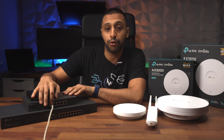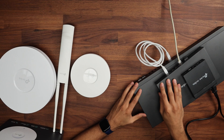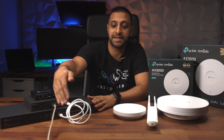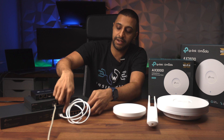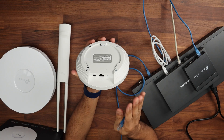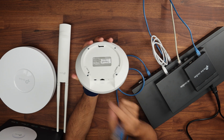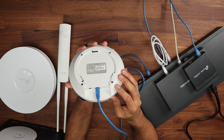This goes straight into the first WAN port just here. We're then going to plug our router into the switch — connect it up to port one on the switch itself. Your internet connection comes in, goes into your router, then into the switch, and anything plugged into here will also get an internet connection. We're also going to plug the three access point devices and the cloud controller straight into the switch. On the back of the access point you do have DC power if you don't have a PoE switch — it comes with a plug — and then we plug the ethernet cable in.